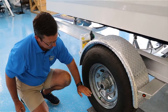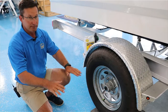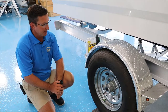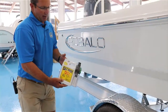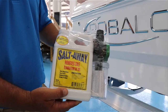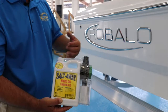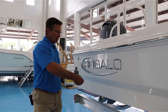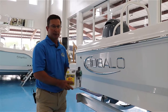Double check your tire pressure. If you've got one side low and one side high, it's just going to ride uneven and be a lot bumpier, so just double check the tire and make sure you're at the proper PSI. One thing I like on the trailers — I love it on the boat too — I recommend this product for cleaning the trailers. It's a product called Salt Away. It's going to remove and dissolve salt, so when you're washing your boat, wash the trailer with it as well. It's going to remove some of the salt and put a little bit of a polish to it.